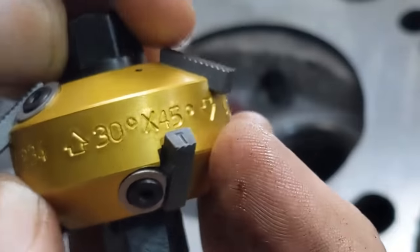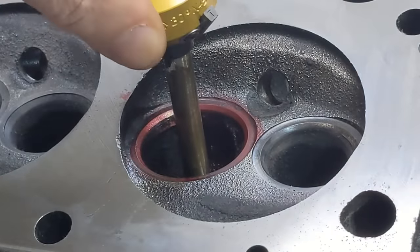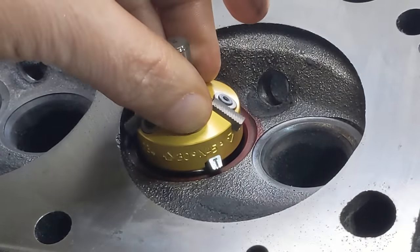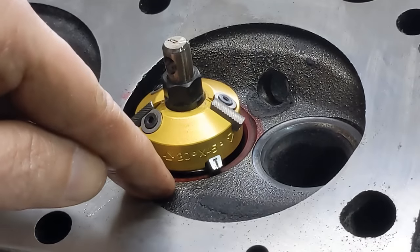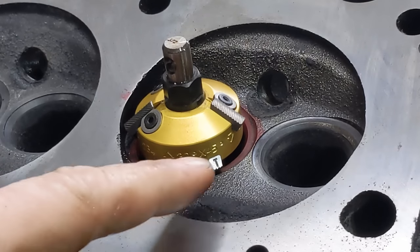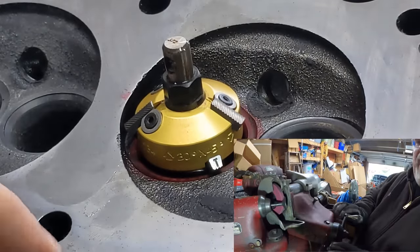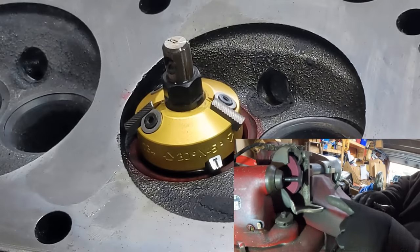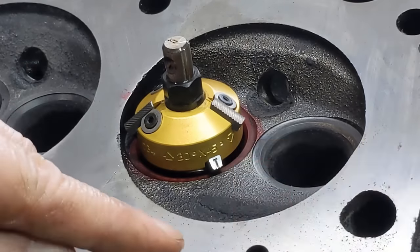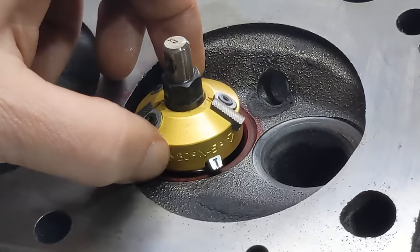Then we start with the 45 degree cutter. The goal is we're going to cut the actual contact surface of this seat that contacts with the face of the valve. The valve face will also be 45 — it may be 46 or so; sometimes they get reground to a different angle. The valves for this I've actually sent off to Dr. Tork — he's going to do those because he has the machine. So we'll have him do those and explain exactly how that process is done. But the goal here is we want this face and the face of the valve to match perfectly. So we're going to cut these at 45.